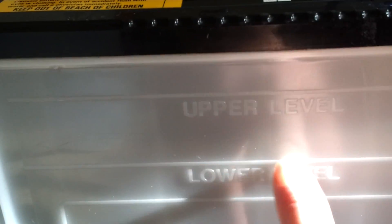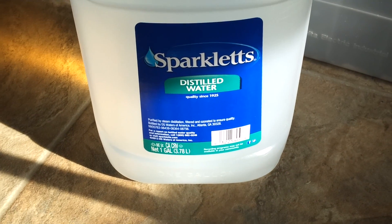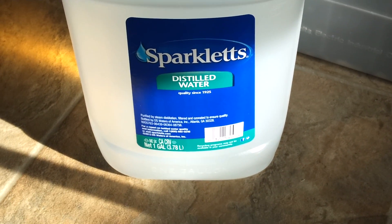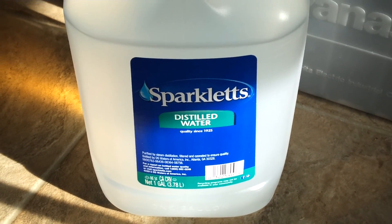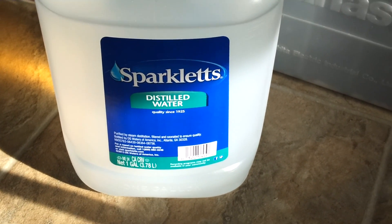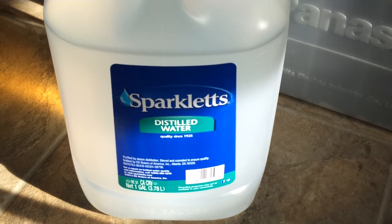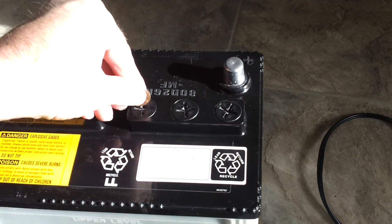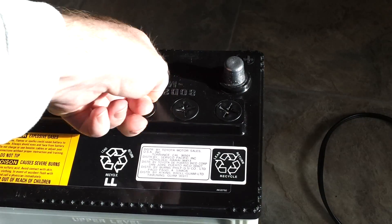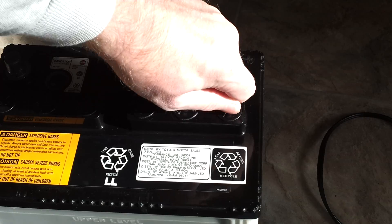So I'm going to fill it up with distilled water. Do not use mineral water, tap water, or artesian water — only distilled water for your batteries. If you use regular tap water, the minerals in it will destroy your battery in a matter of weeks. Use a coin — a penny or dime works well to loosen up the caps on the cells.